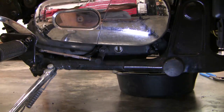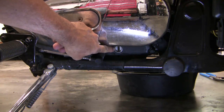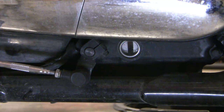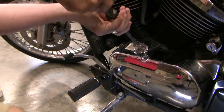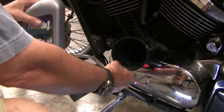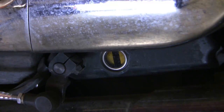Our next step is a little more tricky — we've got to fill it with oil. This bike needs about three liters or so. Now this is the check plug, and I've got the bike tipped sideways on its stand, so it's not an accurate assessment, but I just wanted to show you what it looks like. You can see a little meniscus at the bottom. When we fill it with oil, that meniscus is going to slide upward, and the fill mark is with the fluid level halfway up when the bike is exactly horizontal. This is the fill hole right here — we just undo this. For this bike it calls for 10W40 motor oil. You can see the fluid is completely up, but the bike is tipped on its side.